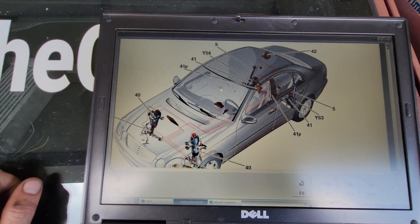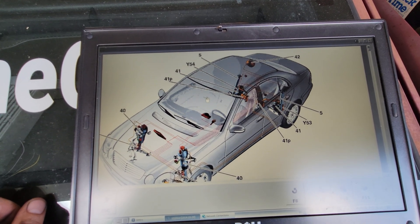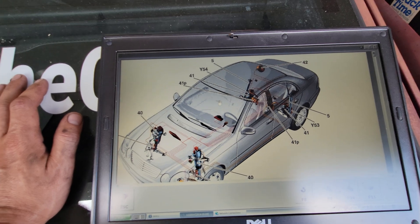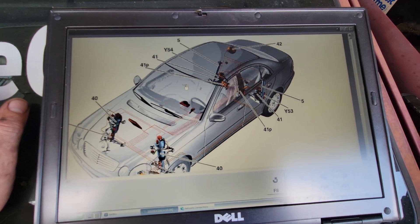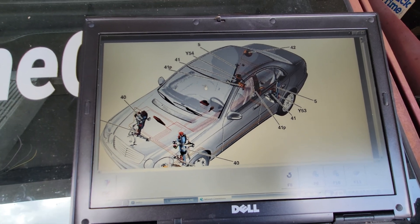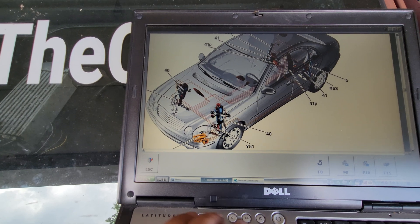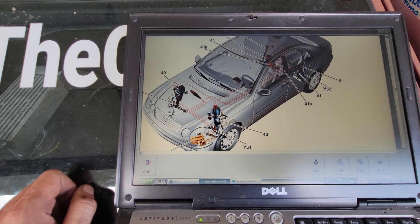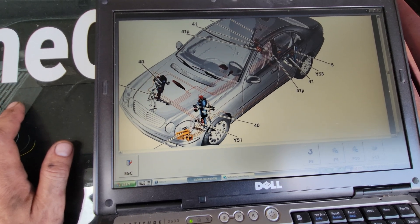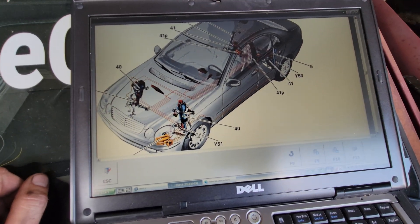What happened in my car: everything was fine, then occasionally I'd come out and the rear end would be sitting low — it's always the rear end, never the front, on these things. Eventually it got so bad the compressor had to run too much and was getting overworked. The compressor is located in the left front of the car. It's actually just a Wabco compressor — pretty much every air ride car I've worked on uses this compressor or the style on GM's and Nissans.